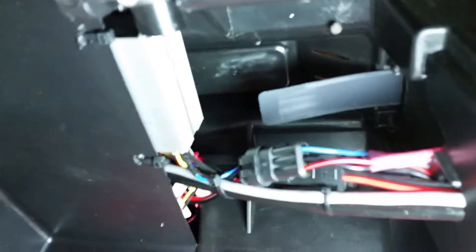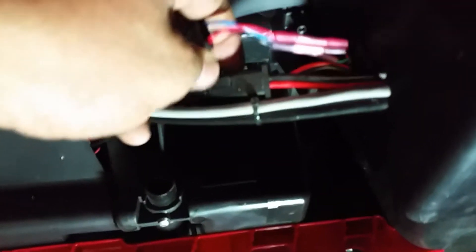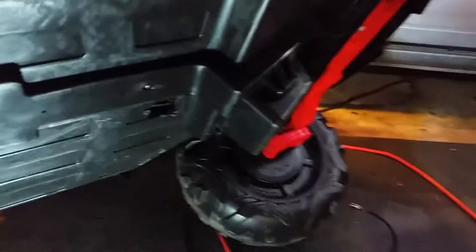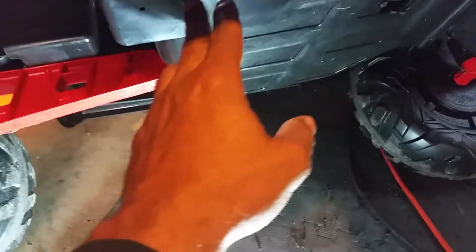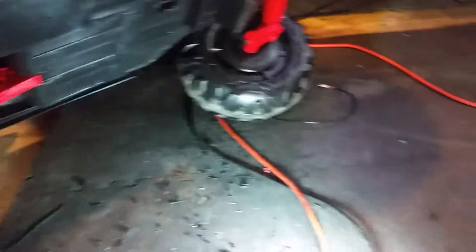For the wiring on the actual speed controller, I zip-tied the speed controller up underneath here and put a watertight connector on the TPS connection. I used battery connectors I normally have laying around for the power into the motors and the power from the battery. I spliced into the stock wiring, cut the old pedal out of the equation, and ran the power wires from the battery through the controller and then from the controller to the switch for the shifter. All the stock wiring from the shifter to the motors was left intact. It works as 24 volt now with variable throttle control, nice LED lights, and the pedal is repositioned so it actually fits her. I think she'll be stoked.